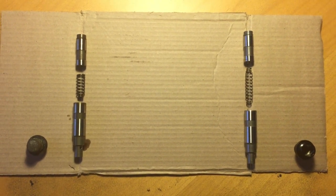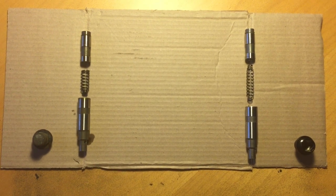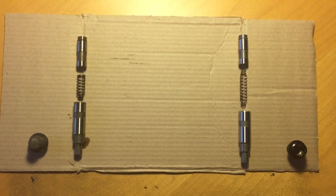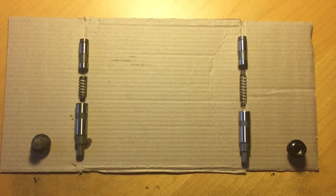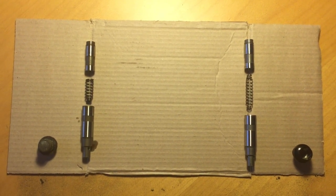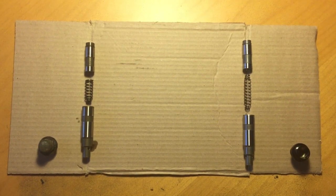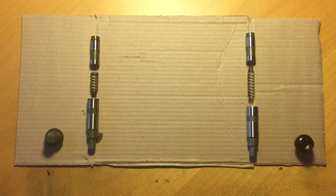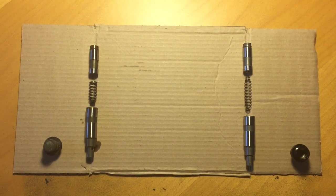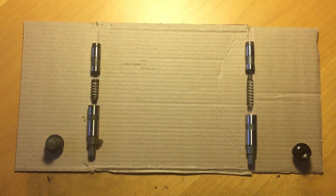So this is what the parts look like. The one to the left is pulled from the car — it has some 300,000 kilometers on it. The one to the right is going into the car. The most notable difference is the spring: the old one is shorter than the new one. Since it's hydraulic, it doesn't really matter because the oil pressure going into the tensioner will self-regulate, keeping it at the most optimum pressure. The black 19mm end is what you tighten into the cylinder block.